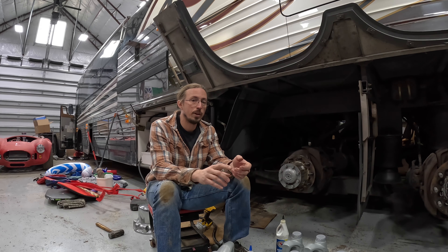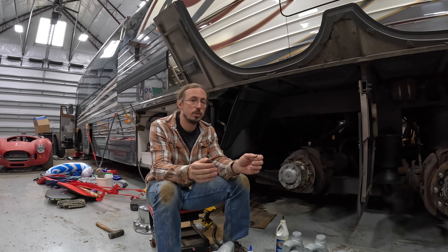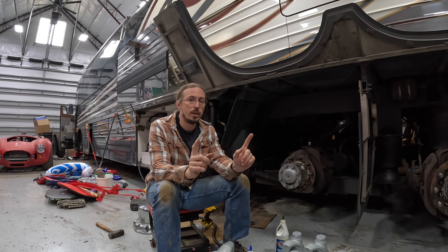When you dig into the Prevost manual, and also the Meritor manual which is ultimately referenced by Prevost, there's a service bulletin by Meritor that calls out different viscosities of oil you can put into your rear axle, and it gives temperature ranges. What's interesting is that basically anything from a 75W90 on up to an 85W140, there is no upper temperature limit that Meritor gives — it only changes the lower temperature limit, where 85W140 is rated down to plus 10°F and 75W90 down to minus 40°F.